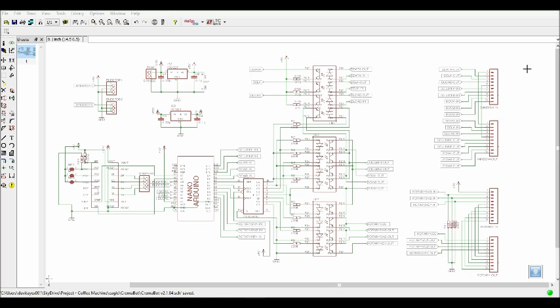In short, from the Jura you have two main sets of input buttons that you want to take care of. One is the 6 buttons on the front of the machine for rinse, espresso, cappuccino, and again for 2 espressos, 2 cappuccinos, and then the steam button. Also included in that is the display, or the data lines that go to the display, which I'll get to in a moment. Aside from that, you have the rotary encoder, where you can do your various selections to integrate with the coffee machine.